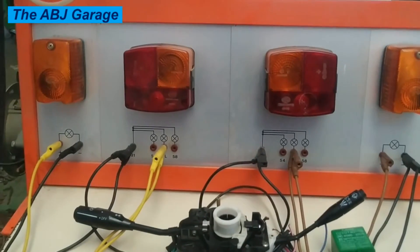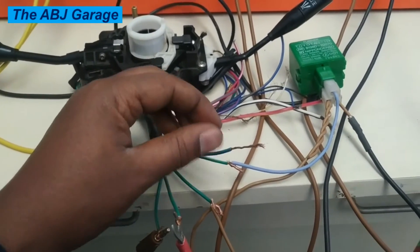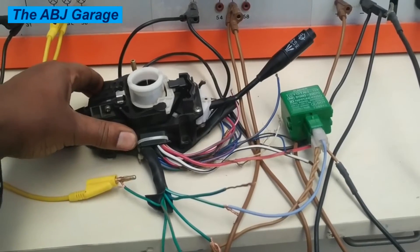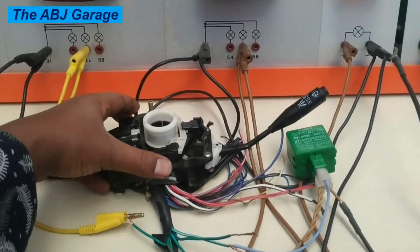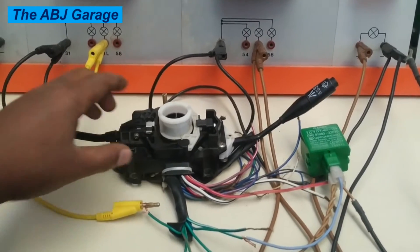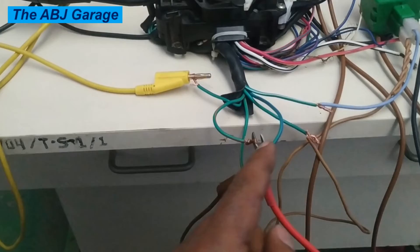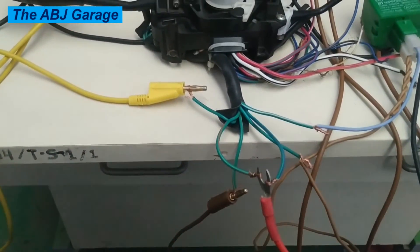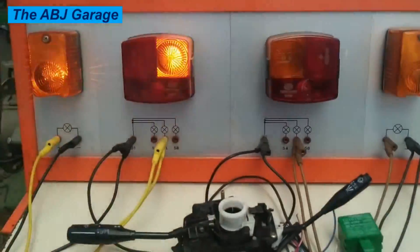Now let's do the remaining construction of the ignition line coming from the ignition switch. Instead of connecting the entire line to the ignition switch, let's give battery supply to this IG and disconnect the hazard. As you can see, when the turn signal switch is operated, there is no signal coming — nothing happens for left or right turn. Now let's power this and see the change. I have now connected the green-blue line coming from the ignition switch, similar to the one coming from the battery. Now see the difference — let's operate the turn signal switch. Now it's functional.